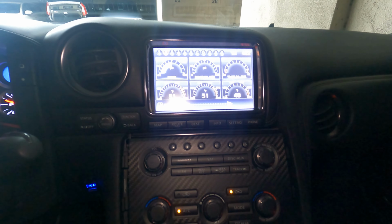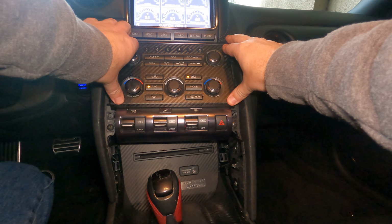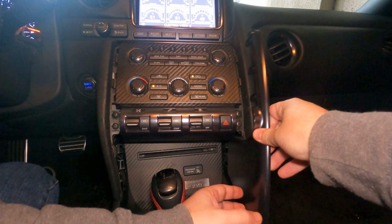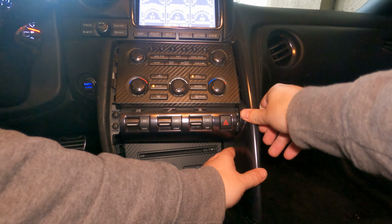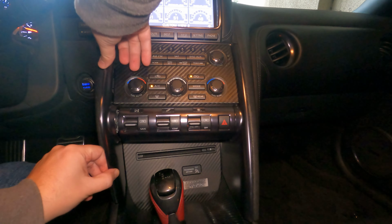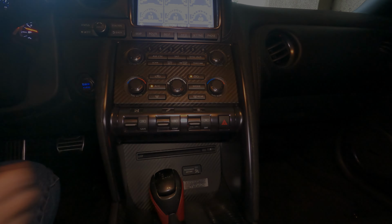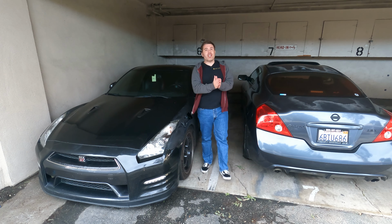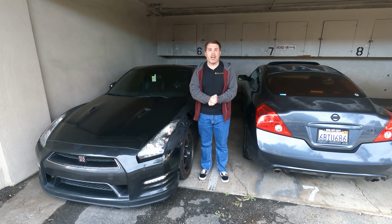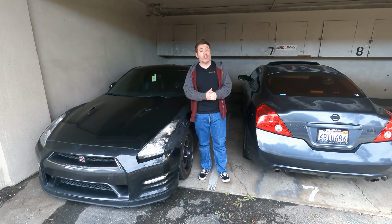All right, I'd definitely say this was a success. Alright, so now let's just make sure that's in the proper place. There we go. And there you go. As you can see, with about a $5 can of WD-40 and about 20 to 30 minutes worth of your time, you can get the knobs on your AC and volume control to be working just like they did when you first bought the car.